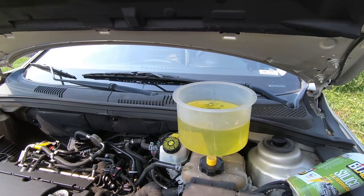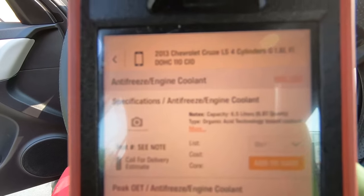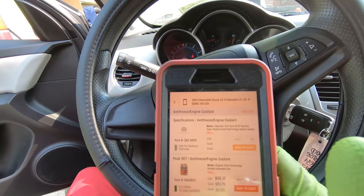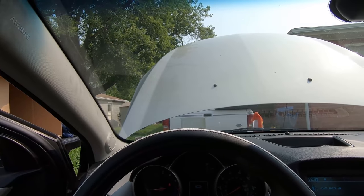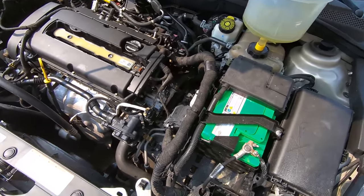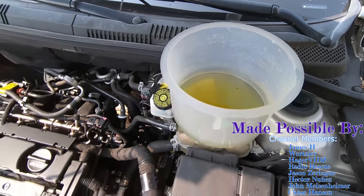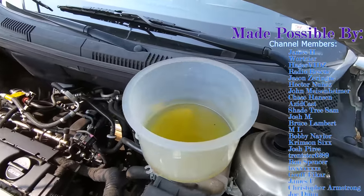Still drinking coolant but I'm going to go ahead and start it up to get that flowing and get those air pockets out of there. Autozone on my commercial account tells you exactly how much the service intervals are, and I have the AllData service estimator so that may be what that's coming from — it's nice to pull that up and confirm how much coolant the system needs. We're pretty much all the way warmed up — that fan will probably kick on any second. You can see how nasty that old coolant is that started to circulate up into my funnel.